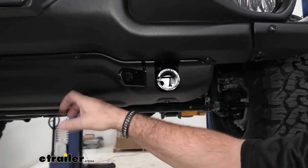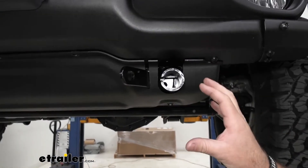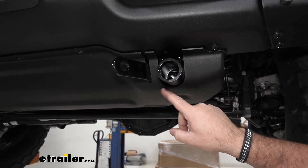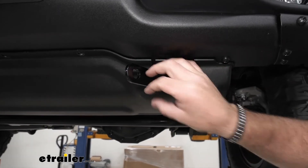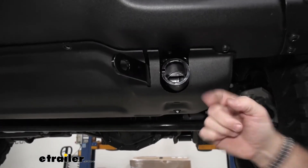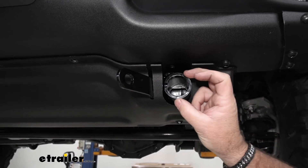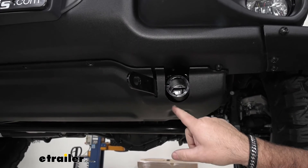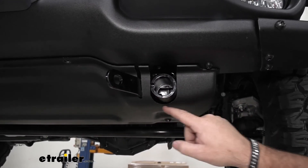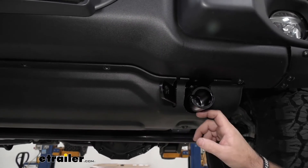Then you can start trimming out your belly pan or rock guard. On the new 2020 Rubicons, this is actually metal — not plastic like the older ones used to be. If you can see here how I cut it out, I wanted to do a little bit more custom work rather than following the directions exactly. If you do it by the directions, they'll tell you to cut out a big square all the way around, so the whole thing will be open. The way I did this was on the underside of the pan — I made a rectangle, then used a two-and-a-quarter-inch hole saw bit, had the bit touch each one of the lines, and drilled the hole. That gave me a rounded circumference on the corners rather than a square. That's completely up to you how you cut it out; if you're going by the directions, just follow the measurements provided.